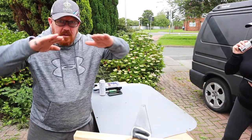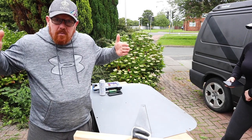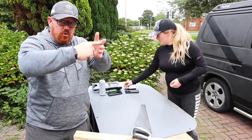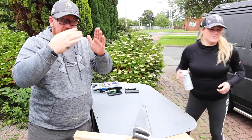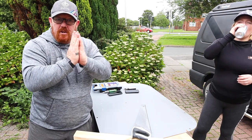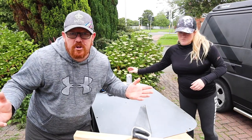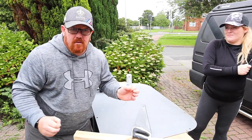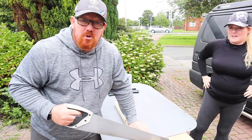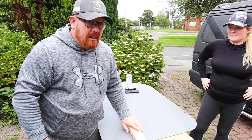What we're going to do now is, at the side where the actual headliner is, we're going to put two pieces of wood down and one on the front, so we can drill through the inside and catch onto the wood at the back — basically sandwiching the headliner between two pieces of wood, which will give it the ultimate strength. They don't really need to be cut to a specific size, as long as they're the same size as the inner bits. Let's get cutting.